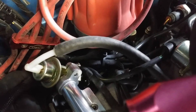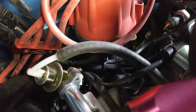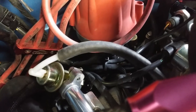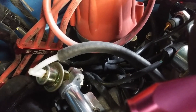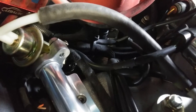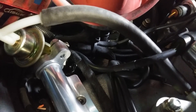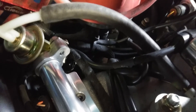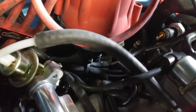It's real easy to mount. One tip is, before you install the fuel pressure regulator, put your 6AN hose on it first. Otherwise it'll be pretty hard to get to — where that 10mm bolt is, it's relatively easy to get to for tightening and loosening. So you can just slide it right into the end of the fuel rail, which makes it a lot easier to tighten up. Thanks for watching.